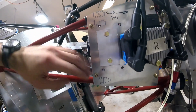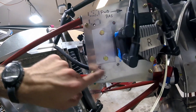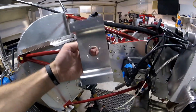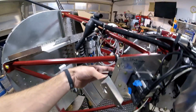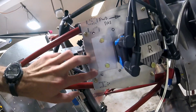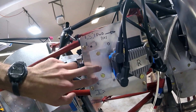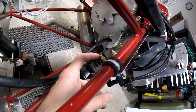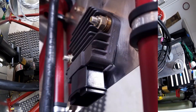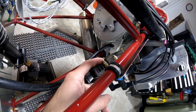Probably could have been a little bit bigger, and I probably could have even used two plates for the thickness. We still have to have access to these rivet holes, which this little housing is going to go on for the cooling air to actually hit the voltage regulator. I just cut it down here at about 59 millimeters in length, mostly centered it up, and drilled a few quarter-inch holes through it. Then I got some longer bolts — these are dash-11 bolts, I think.